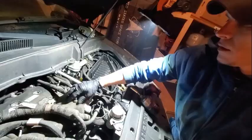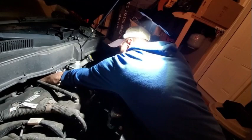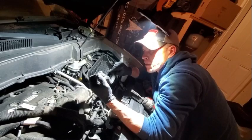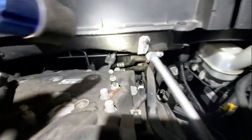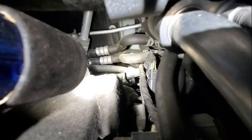This is the dirty side PCV hose that comes off the back valve cover back here. There's a tang — you just press it and lift up off the valve cover. That piece back there is actually your PCV valve. If you're having oil consumption problems on the 3.6, that nipple right there is the PCV valve — it's built into the valve cover. So just put a new cover on it, it'll get rid of your breathing problems.